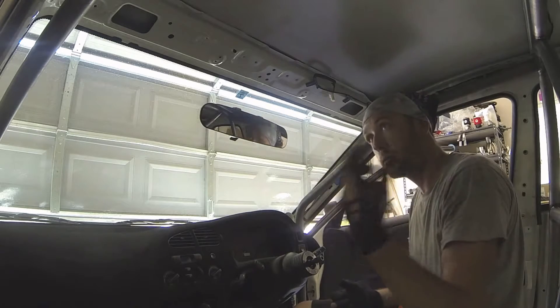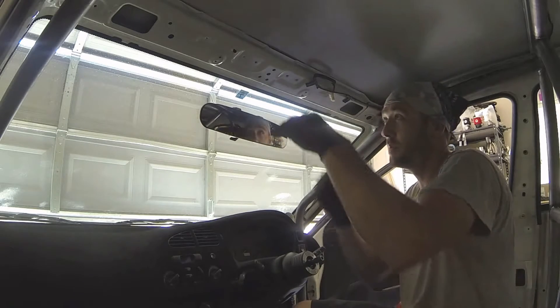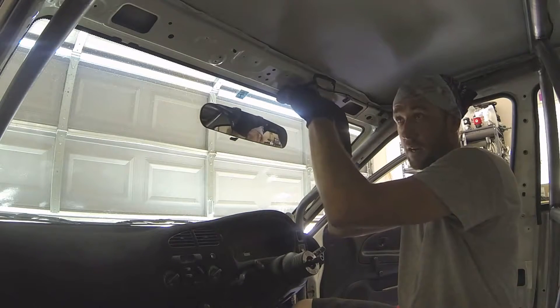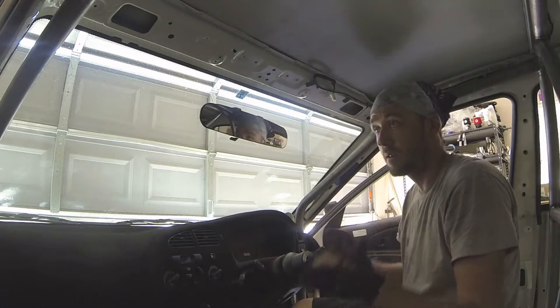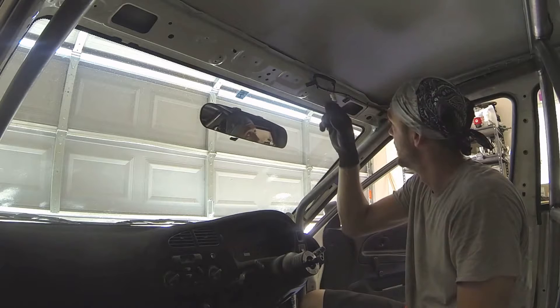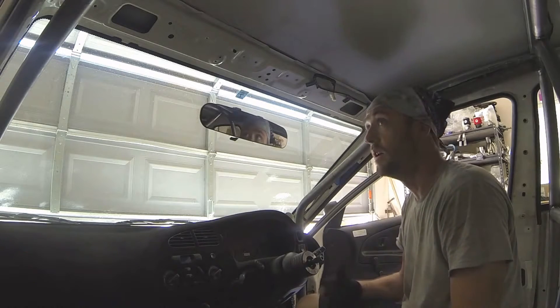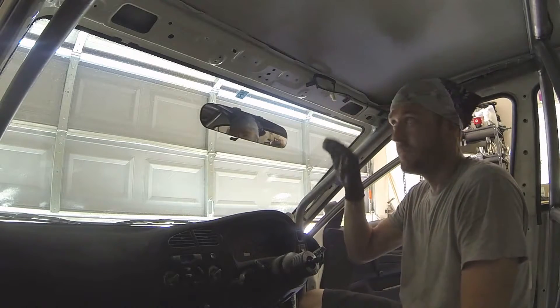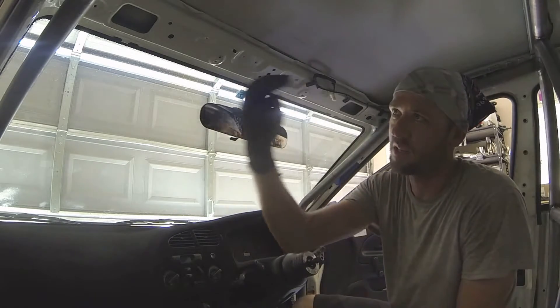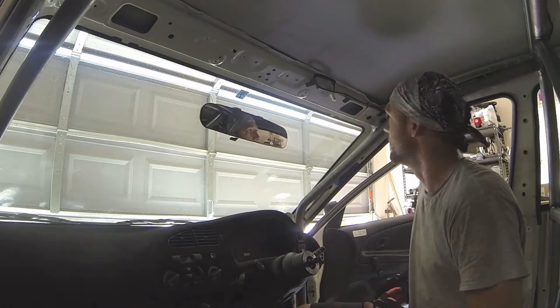To increase the structural rigidity of this cage and the safety of it, I'm going to put it right underneath this roof rib right here, because when this impacts — if it ever flips over on its noggin — this will help in conjunction with the bar itself to keep the driver safe. At the point where it's going to sit, it's not going to be in the driver's field of view, so we can run with a very simple design and just run straight across.